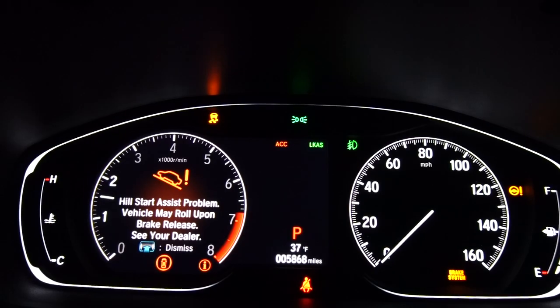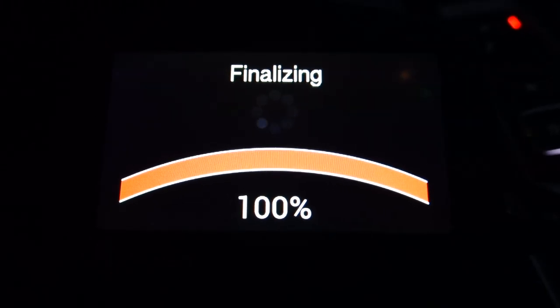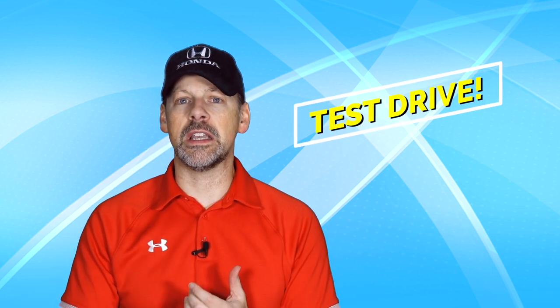Once you've uploaded your flash and tuned the car, just be aware that all sorts of warning lights are going to go off — and that is perfectly normal. What I did was after the flash was downloaded, I started the car back up. All the lights were lit up. I drove around half a mile to a mile, the lights were still on, but once I got back and turned the car off then immediately back on, all the lights were gone. So now that it's installed, let's go take a test drive and really see if we can feel the difference in horsepower.